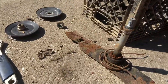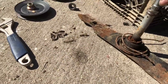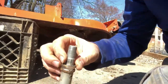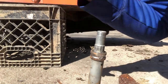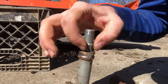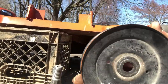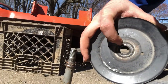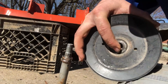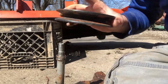They might get loose, but since you're replacing everything when you get the kit, that's okay. Now, let me give you a little description since I have it out here and it's easy to see. Right here, see this? There's supposed to be teeth there, which I'll show you on the new one how pronounced they are, but these are grooved teeth that go inside this, and you see this is pretty much missing all its stuff as well. You can kind of see the indentations where there was a pattern. Again, it's supposed to be like gears, and it locks together.